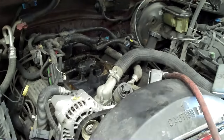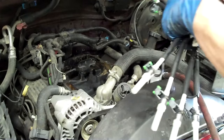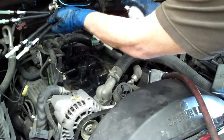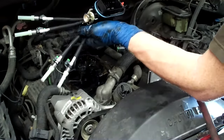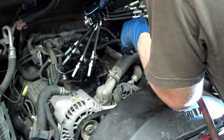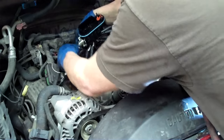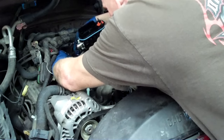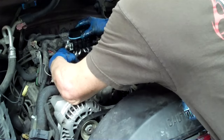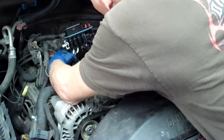Here we go. So when you go to put these in, you don't really have O-rings here — everything is just kind of open in the intake. I'm going to spray these with spray silicone also. The way that these go in, these end ones go in first. Notice that I'm not putting it in the bracket first — that's intentional. So I take that, stick it in there, and I'll get it to where it's got the lines in the bracket, but it goes in the bracket kind of last. This one goes underneath to the outside on the end.